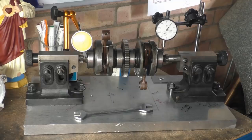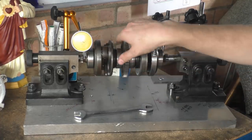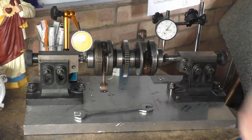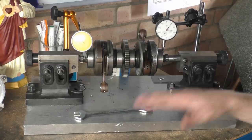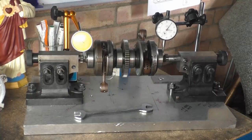There are many ways you can do it. I like the center-to-center way of doing it like this, where it's between centers so the whole thing can rotate. You can see that the rods have been cable-tied up because otherwise they end up just flapping everywhere and hitting everything unless you've got enough clearance, which this stand doesn't. I always used to basically cable tie or wire up conrods so they don't start flapping around.